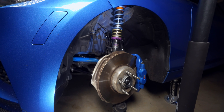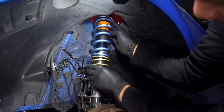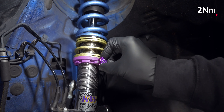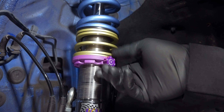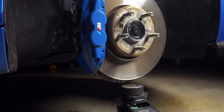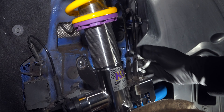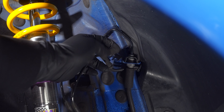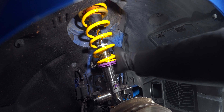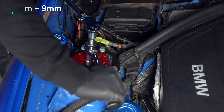Now we can lower the jack and adjust the height. Considering these springs are almost double the spring rate of the KWs but the overall length is similar, I started at 7¾ inches from the center of the pinch bolt to the top of the spring perch — on the lower end of what KW recommends, which we still need to be mindful of. The big thing is that we want the strut to still operate within its optimal stroke range, as working outside of this could reduce performance and cause the strut to fail prematurely. I'd suggest starting at the lower end of the recommended range and driving it for about a week before going down a few spins and retesting.